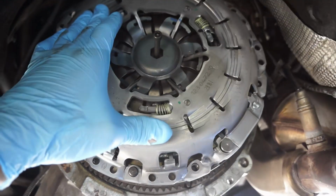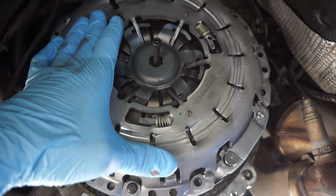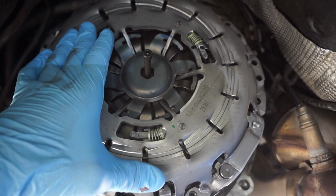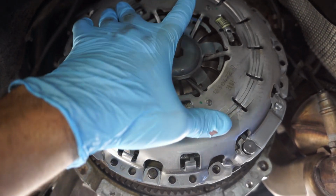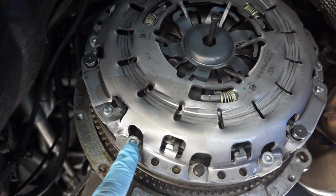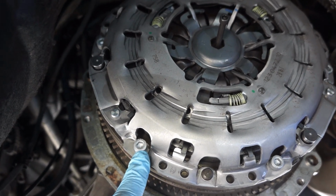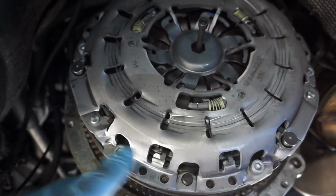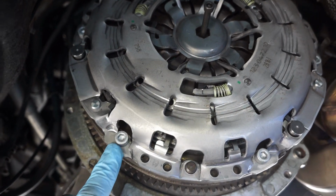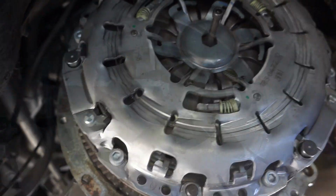So now you just start putting the bolts in, and I got new bolts. Part number will be in the description below. They're M6, and they go all the way around the outside of this pressure plate. I got all the pressure plate bolts in, these 6 millimeter Allen, and I just hand tightened them for now all the way around, and then I'll do them in a crisscross pattern to 25 foot pounds.